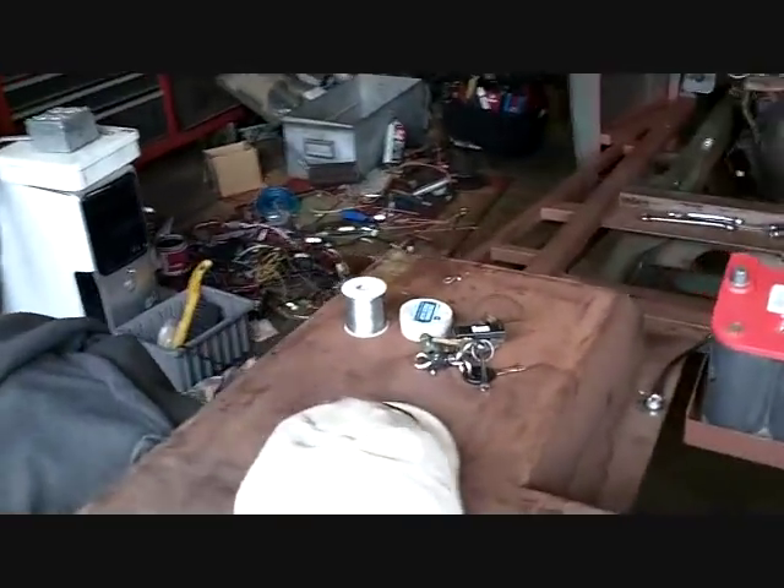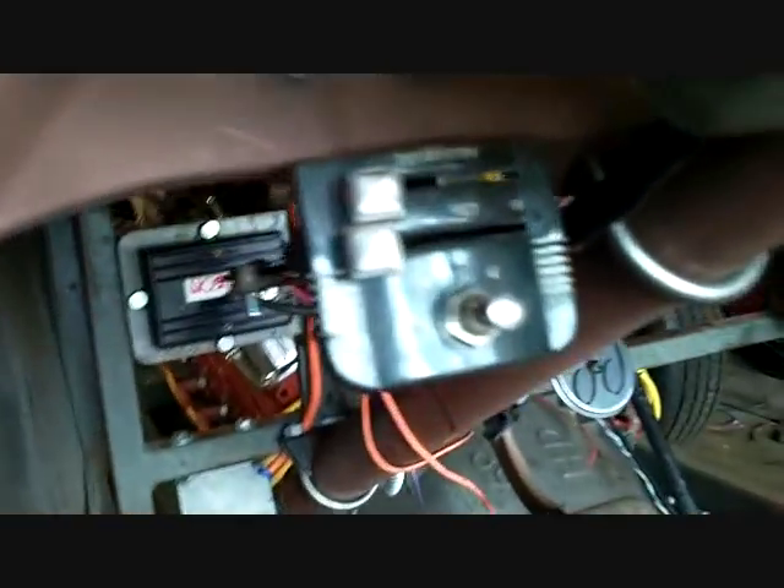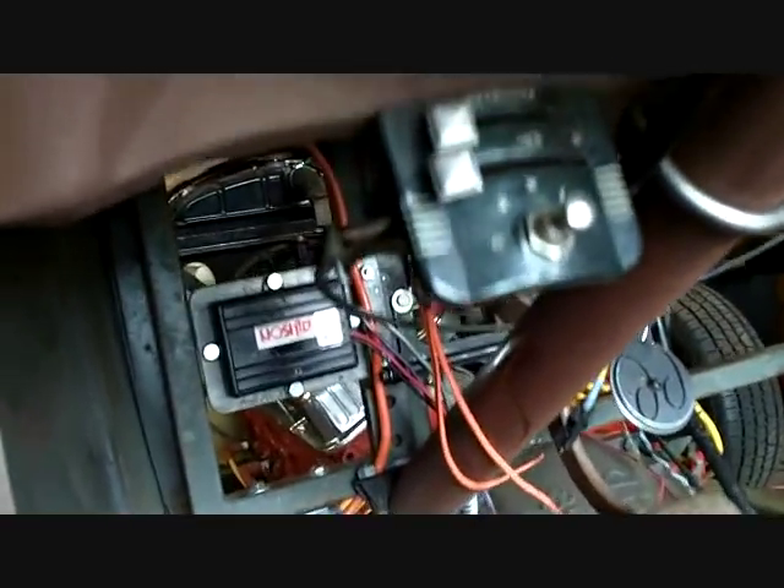So we're on high, medium, and low — that's a nice smooth glide. Imagine that. Thing's got to be as old as the car. It uses a little 8-32 screw to pinch the cable, and there's a clamp around the steel cable that does a loop. It goes up to the outside and I'm going to have to pull this up a little bit. The reason I had to put it visible is because my heater core mounts on the firewall, so I had no place to put it except right there. But hey man, the car is 80 years old — be lucky it has heat.